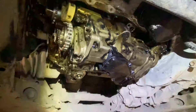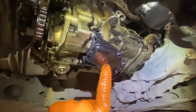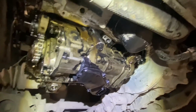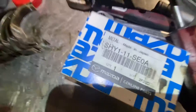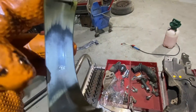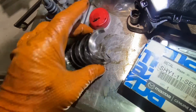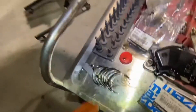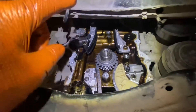I decided to also fit the oil pump and balance shaft module. What started as oil-related issues that I thought was going to be just a gauze turned out to be the chain broken when I dropped the sump off. I've changed that chain and also put in a set of big end bearings. I've done many videos on those so scroll through my Mazda stuff and you'll see me changing these. The gauze is there with a part number if you want it. On the bearings - it was wise to change them, you can see one is pitted in there, a bit burnt, but the rest seemed fairly okay.